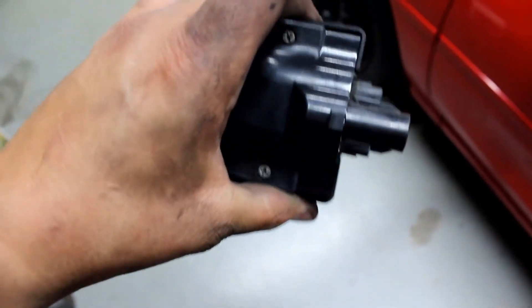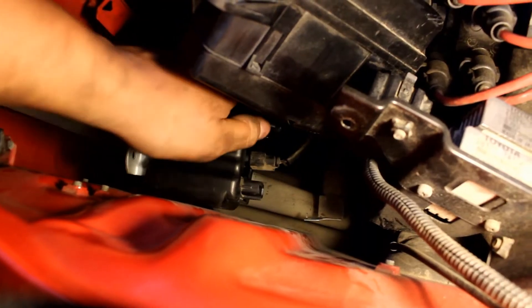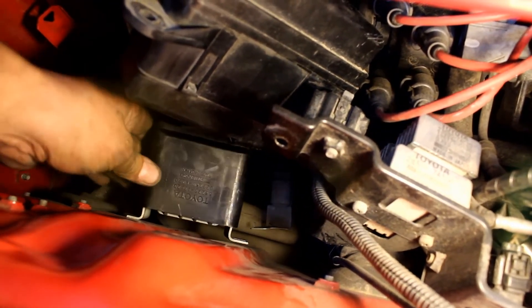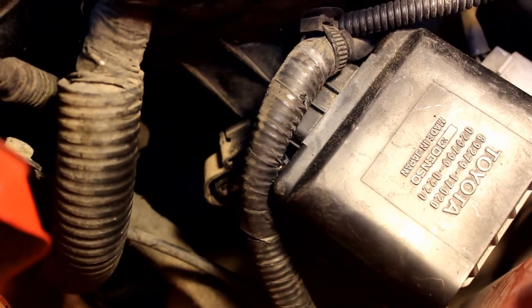It's all back together and the Phillips heads are tight. Now putting this sucker back in — first thing is to plug in the coil wire, make sure it clicks. Rotate this in to get it mounted back up. I put in different hardware from Ace Hardware — they have 8 millimeter heads instead of 10 millimeter heads so it made it a lot easier to get them started and screw them in. As you're screwing in the passenger side, make sure this little relay is tabbed onto that bolt. Once everything's bolted in tight, plug that top plug back in.